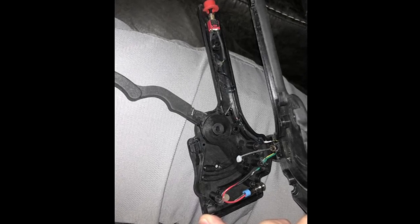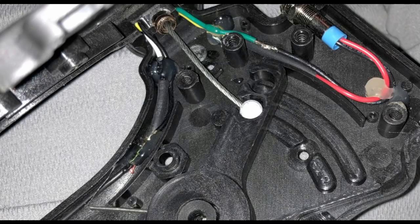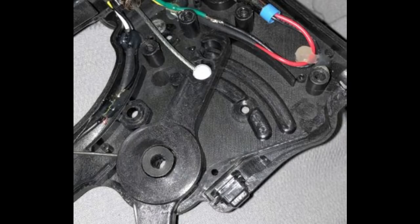Tracing those wires into the throttle housing, I felt the wire management inside is pretty poor. There are soldered wires that are left exposed and just simply hot glued in place. I would like to see more shrink wrap tubing used inside — while I realize it's just as functional without it, it speaks to quality in manufacturing and attention to detail. Also inside the throttle, there's no lubrication of any kind on any of the moving parts. A dab of light grease goes a long way to prolong the life of the throttle and prevent unexpected hangups in its operation. Considering that stuck throttles is the number one cause of injury, this is an area that could certainly be improved and at least a little more thought here would give me more peace of mind.